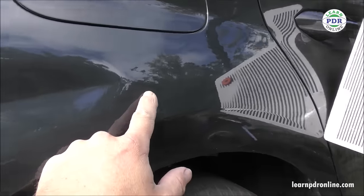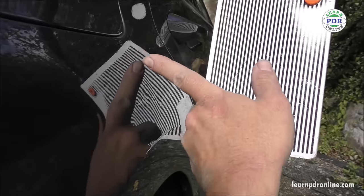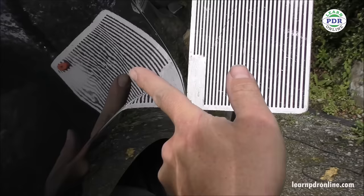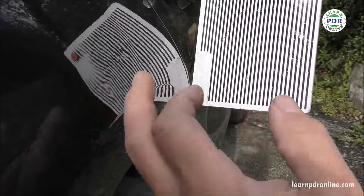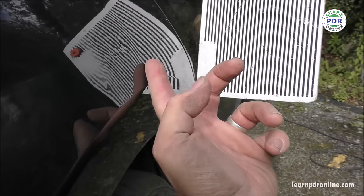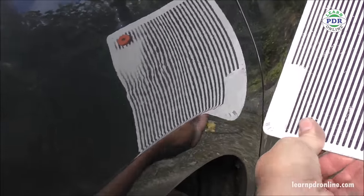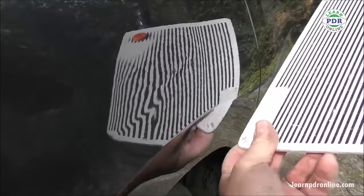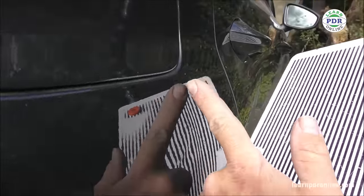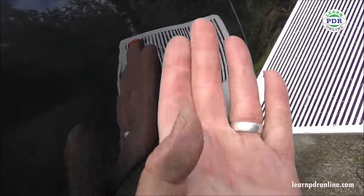I'm just repairing this little crease here, but from this angle you can see I've got crown. I quite often call this hidden damage - that's where the damage has travelled across, got to a point, and won't go any further. So it creates a bump crest in the panel at the very edge of the repair. It can be quite easy to miss, but that certainly needs to be tapped down to have that little bit of tension and crown released, allowing that metal to flow each way.